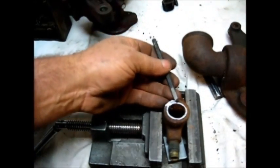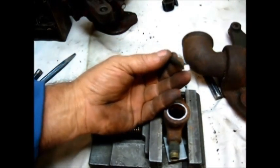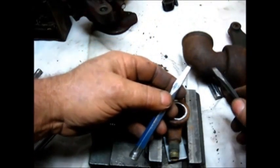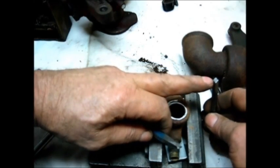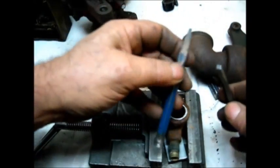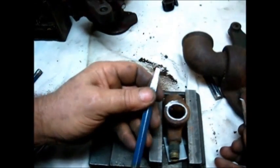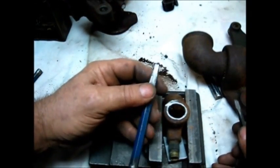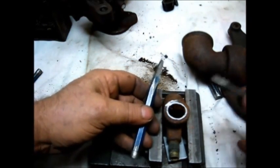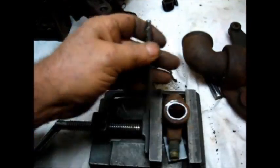Once you make that decision, you see this chisel right here? I ground it like a diamond — as compared to this one, which is straight across. You couldn't cut a keyway with the straight chisel unless you took a corner cut, and you'd need both of them to clean up the corner. I looked that up — let that be the lesson for the week: how to cut a keyway and what kind of chisel you need.